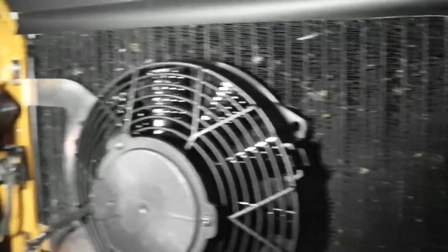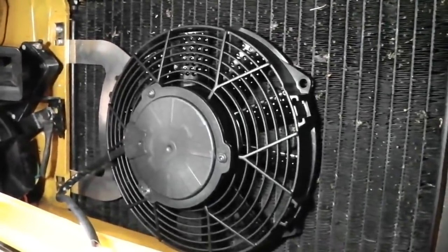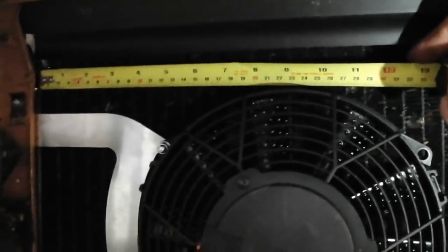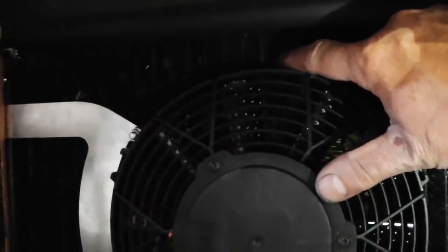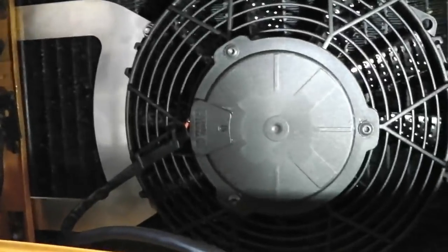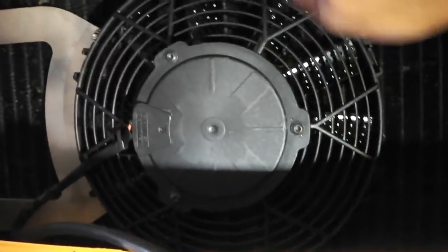We now attach the other bracket, slide all the way to the left, and we should be able to fit it both sides. Plenty of light there for you for a change today, guys. Let's get this Revotec kit in. Okay, just so we know, it's central. 22.5 is the middle of the rad, which corresponds to this core here. So the middle dot of the fan for that one, that means we're done exactly in the middle of the rad, which is like, just keep everything parallel, symmetrical, makes me feel better. No reason why you can't, just as easy to get it right now. So the center line with the center core, so we're bang in the middle.